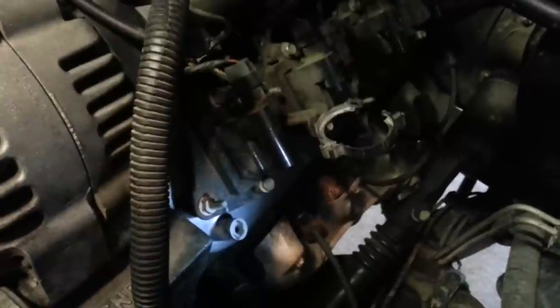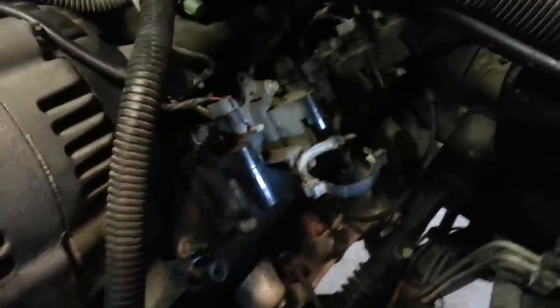That's what holds the coil pack onto this head cover. So it's just sitting there. They're not combined in any way or one shape or the other, but this is what holds him down. So we're going to remove all four of those, and this whole coil pack will come right off. So I'm going to go ahead and do that. I'll try to film it maybe. And then we'll move to the next step.